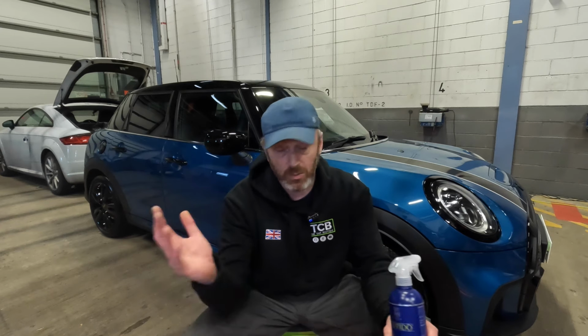The Veneer is a game changer. The Cupido is a fantastic product, so easy. You spray on, you level it, you wipe off, there's no curing times and all that kind of stuff. I'm going to leave this for a few hours. That's why I'm not doing a hydrophobicity test or anything like that. And the longevity with this sort of regime is between 5 and 8 months, depending on your wash regime and all the other variables that affect longevity.